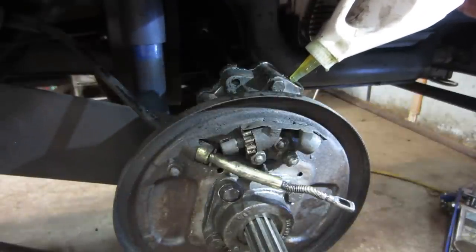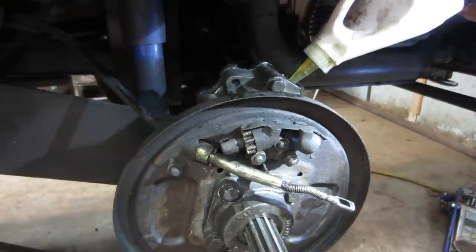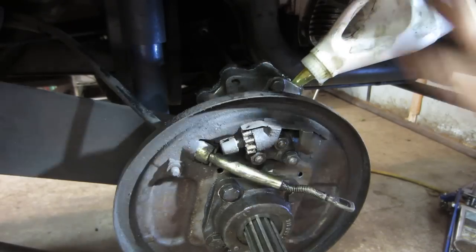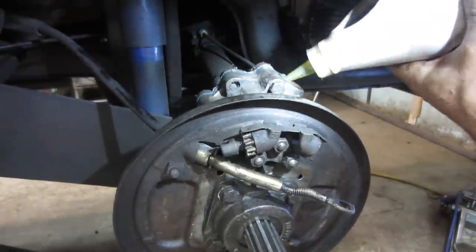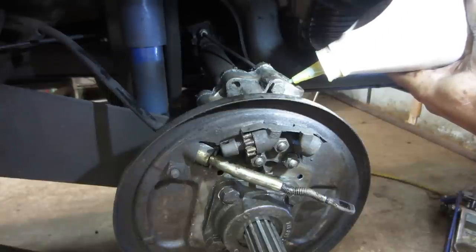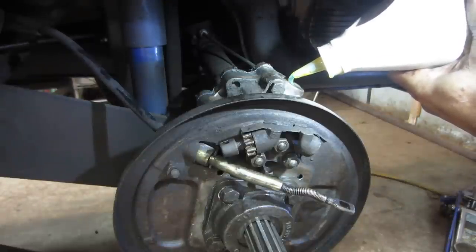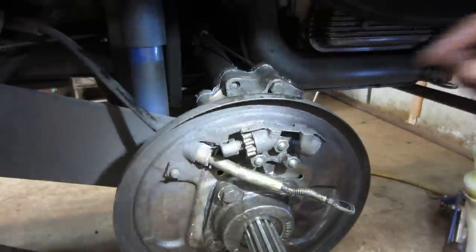Again, you fill these up, but at the same token, it will leak from the transaxle down to the gear reduction. Some of the guys that lower them, the problem is when you lower them, the axle tube back here now faces downhill to the transmission, not downhill to the gear reduction. So the fluid goes from the gear reduction and doesn't maintain the level it's supposed to. When it starts slowing down like that, you know you're kind of back feeding up the axle tube now. So let that settle. I'll tweak that a couple more times.